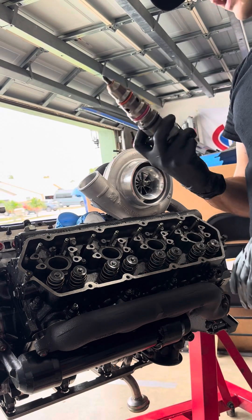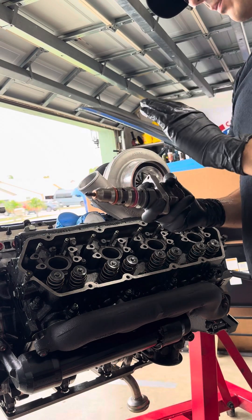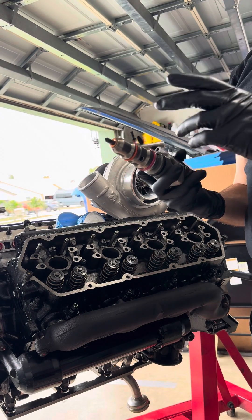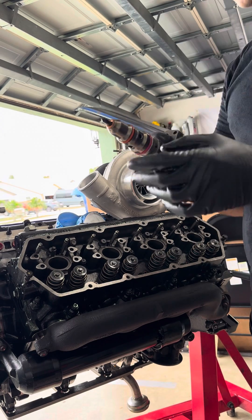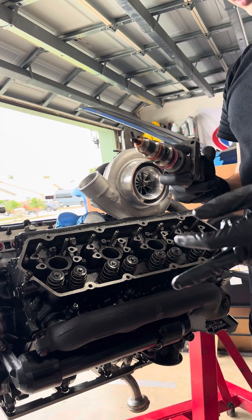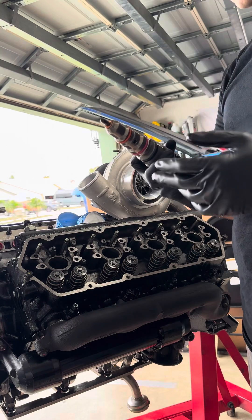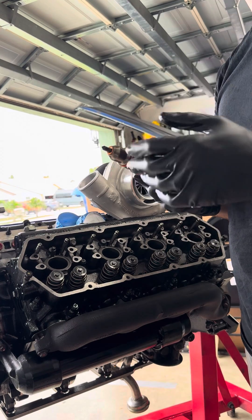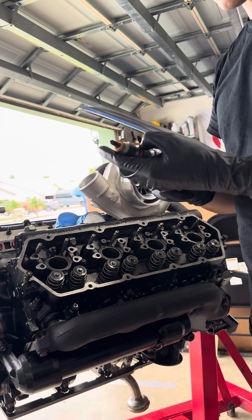There's a lot of stuff floating around on social media. A lot of people think that you can just take this injector, tap it in on the back of your hand, and pull the injector the rest of the way with the hold-down bolt — and that is 100% wrong. If you do that, the injector may not seat correctly, you can have running issues, the truck may not even start, and you'll have definite performance issues. The improper installation can severely damage the fuel injector.